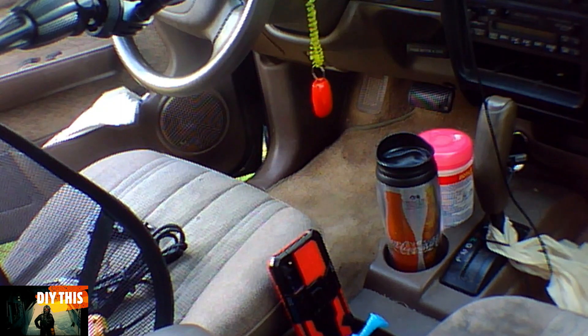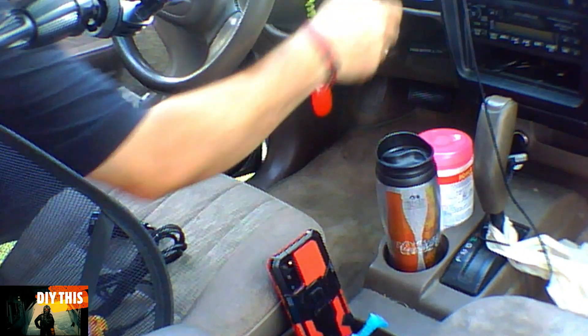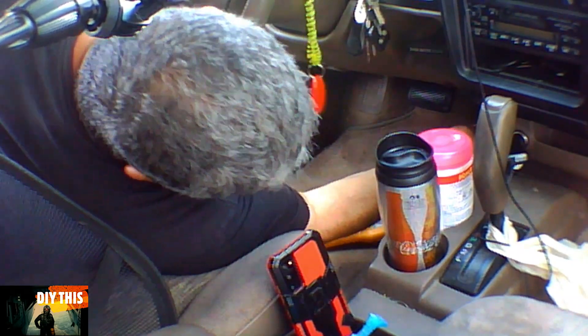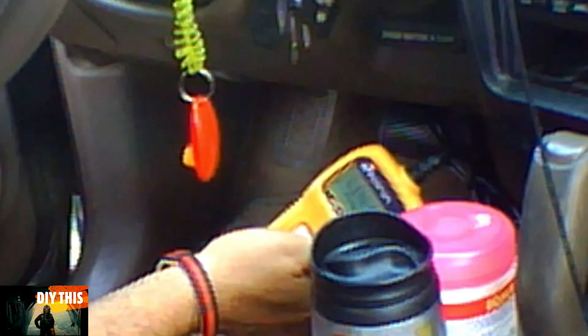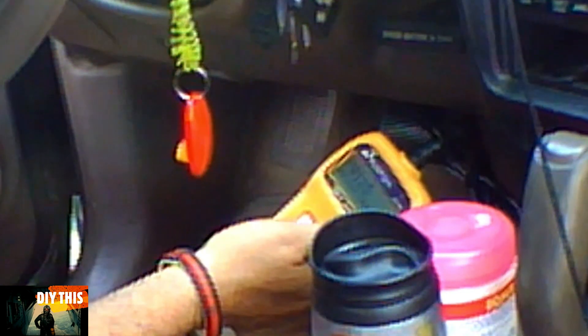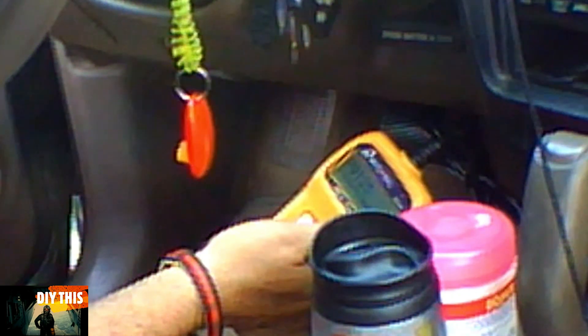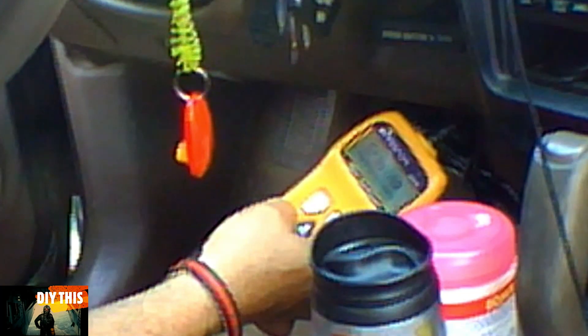It's old, it's got some rust on it, but it's worth saving. I pulled the codes out of the OBD2 — it was clear that was a P0125, which is a temperature sensor. It's located behind the engine, right below the valve cover. You could probably take it out without removing the valve cover, but I was afraid of breaking the plastic piece that attaches to the brass sensor.